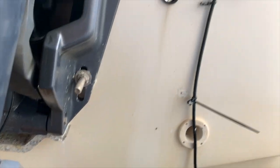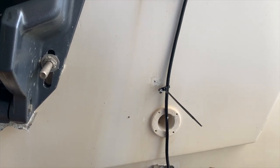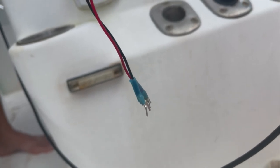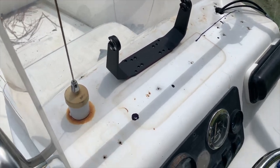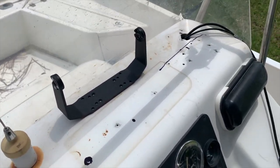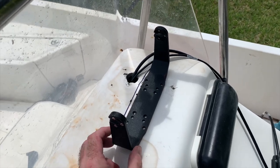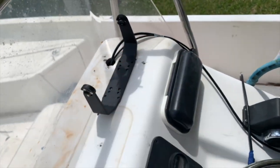Nice and even with the bottom of the boat. Got to mount two more screws to permanently mount it, zip ties up there to hold in place. Day two — it's hot outside but we're finishing today. Here are the power leads. I put heat shrink connectors on the power leads with open-end connectors going into a fuse block. The red power lead is fused, the black goes to ground under the dash. You could also use an inline fuse.